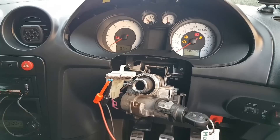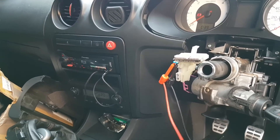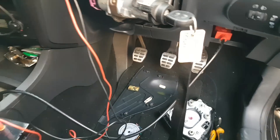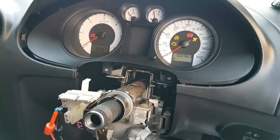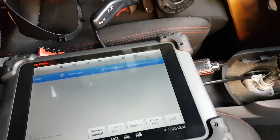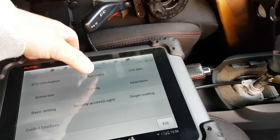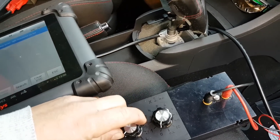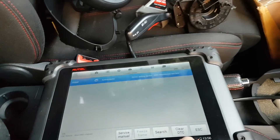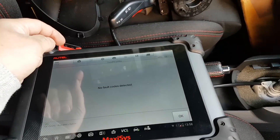Now I'm a little confused. I've set the tool to 0.9 ohms and that triggers the light straight away, saying the resistance is too low. I can't clear the fault - I go back to read codes and the fault is there again. If I go to 1 ohm and clear this, as you can see my fault is gone.